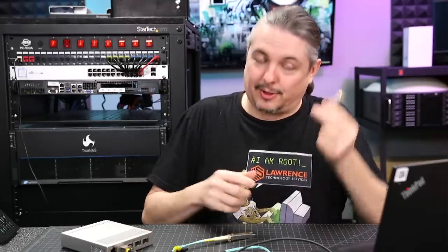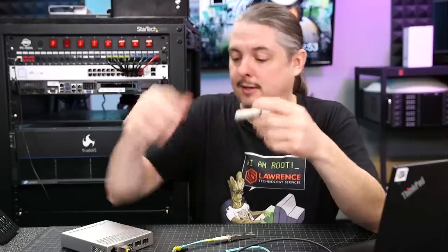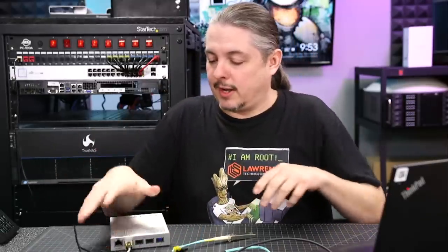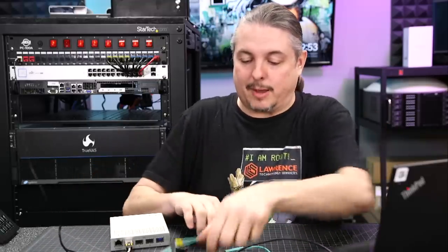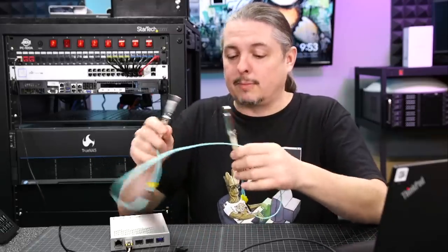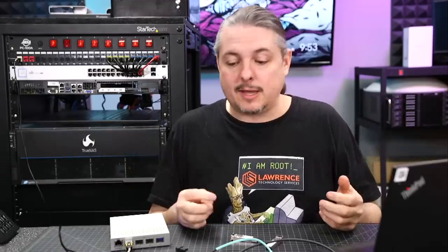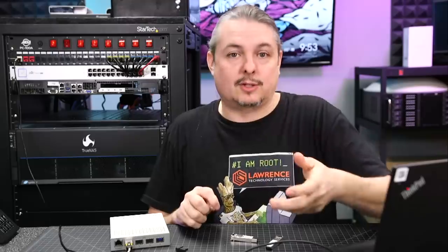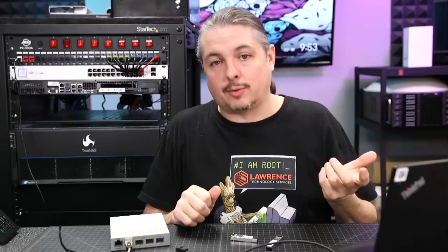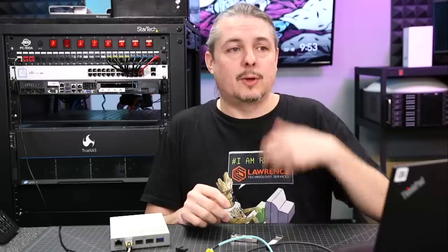It may not be practical to buy a bunch of the RJ45 SFP+ adapters — they're about $43 on Amazon. While they do 10 gig, they do come with that heat expense. But if you need to get 10 gig somewhere, it's an easy way to do it. The other option would be running an optical cable — you can get patch cables prefabbed, or splice fiber yourself if you have the tools. Fiber is great if you need to get it down the hall or over distances exceeding what you can do with UTP cable.